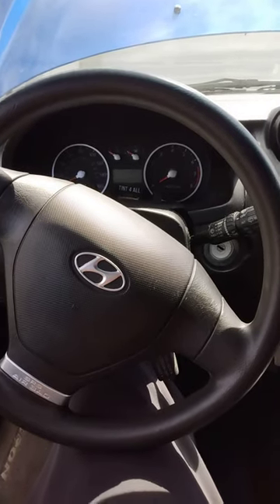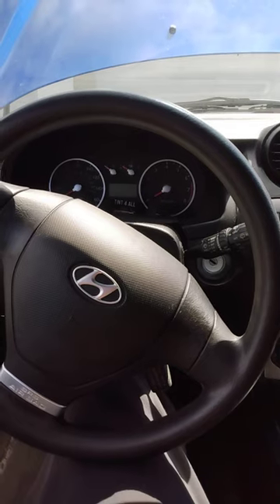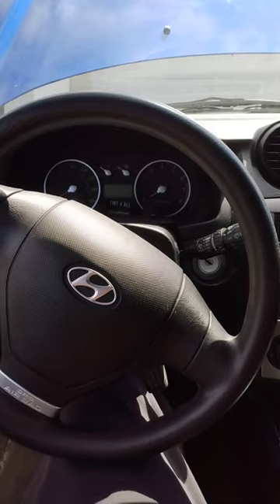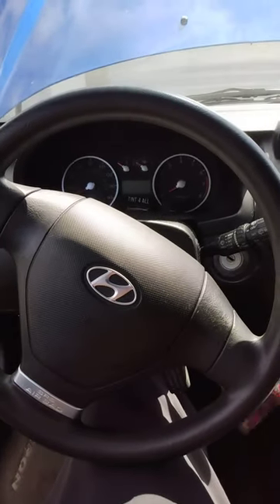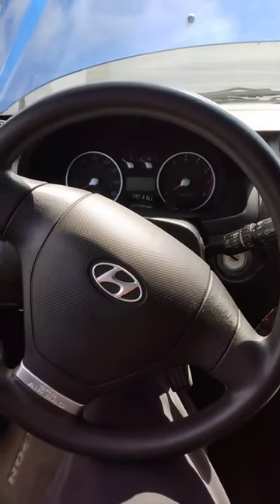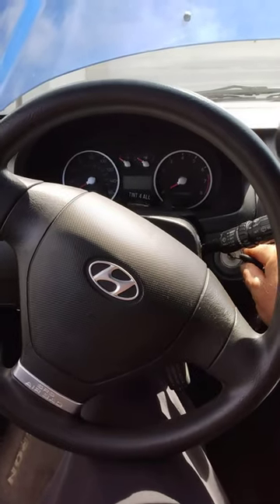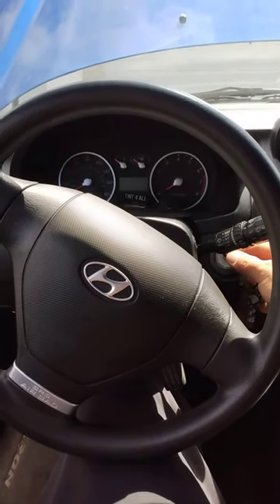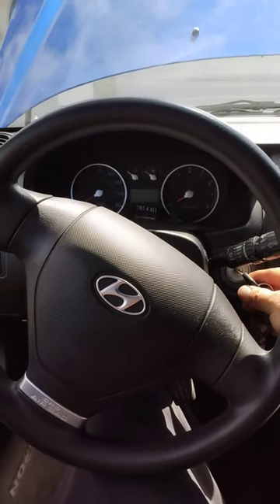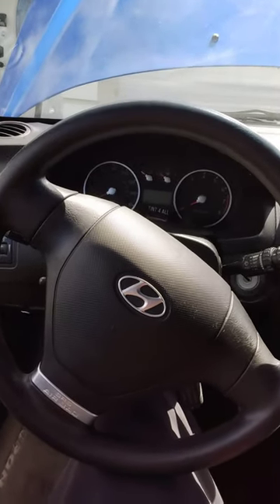I'll need to get a new key fob. Leave a like down below and if you like it, subscribe — it always helps the channel. I'll do other car videos and tips and tricks. But the main thing is: turn the key, wait until your alarm stops, then turn the key back to the LOCK position, count to 10 seconds, then go back to ON position and start the car. Thank you.